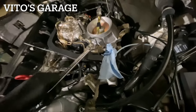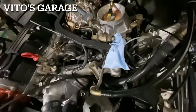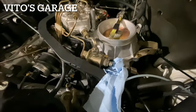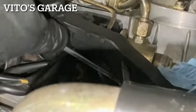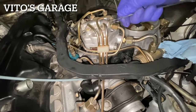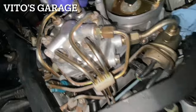There's a lot of pressure in there. I'm wondering if something is up with this fuel pressure regulator, because there's also fuel coming from underneath this line, but nothing coming out where it should be during cranking. I think this fuel distributor is no good or it's clogged, because there's no fuel coming out of any port here.